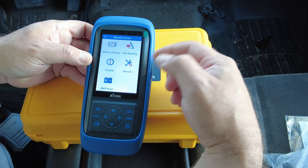Before moving on, here's the full list of system types on this vehicle: powertrain, ABS/brakes, heating and air conditioning — where you can control all the different vents, blend doors, and temperatures — and the body control module. There's live data available with every one of these modules, plus actuation tests unless a particular module doesn't have bi-directional control. A more modern vehicle will probably have a much bigger list of functions.